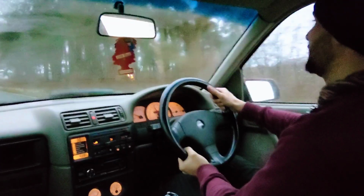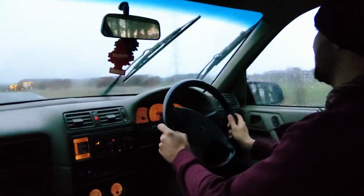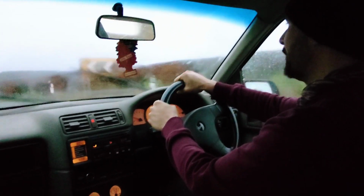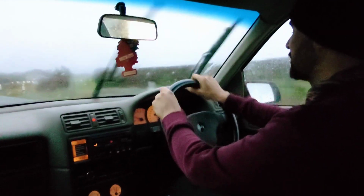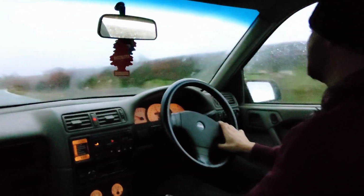I did have the 3-litre injectors in it, but I took them back out because the fuel economy was quite noticeably worse, and I suspect that the 2.5 management was overcompensating on the fuel with those injectors. Just a guess.